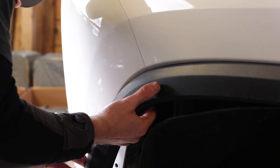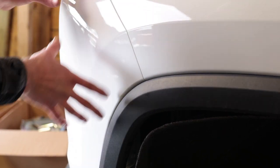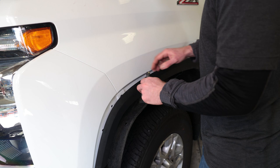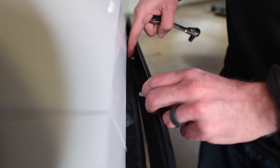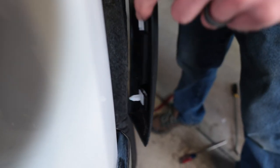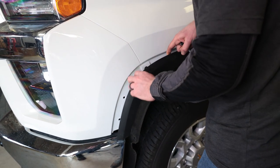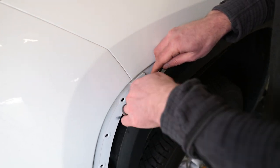There are three clips total that hold this trim piece into the front surround around the headlight. We ended up needing to release the wheel well trim a little more — the first three we released right here, then three more to get access to a 7-millimeter bolt that holds this front cover panel in place. The two outer clips are smaller, the middle one is a little longer and yellow, and the ones further down are longer triangular ones. We broke two of those. I called a local dealer for replacements — there are actually three different clip types, so when you call, it may take a while to identify which ones you need. We'll have part numbers linked in the description.